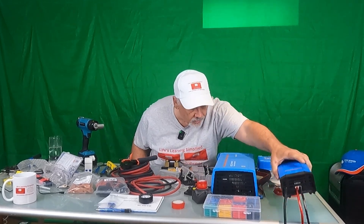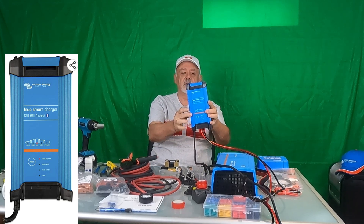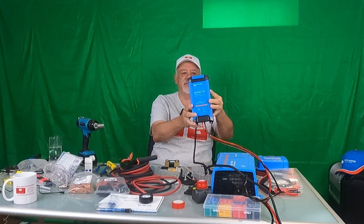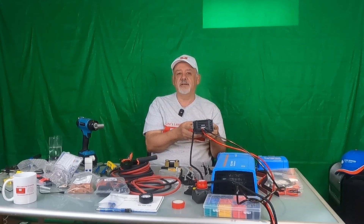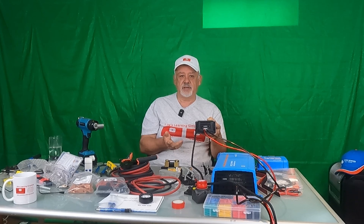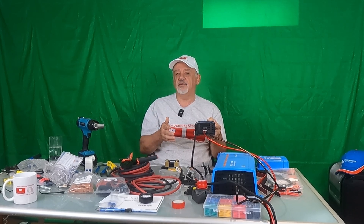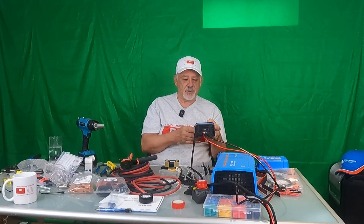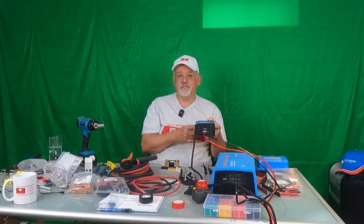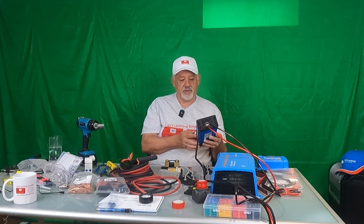Another way to power using the Victron system is their amazing 30-amp Victron BlueSmart charger. It can be set up to charge at different amperages for different situations, and it'll do bulk and absorption charging. When your batteries are just about full, it pulls back to make sure it doesn't damage your lithium batteries. I found it really amazing that this charger basically makes no noise — there is no fan noise while it's in operation.